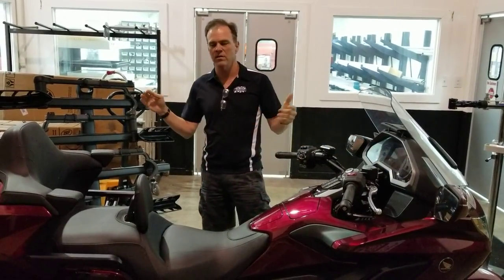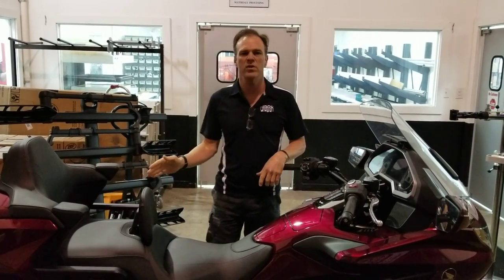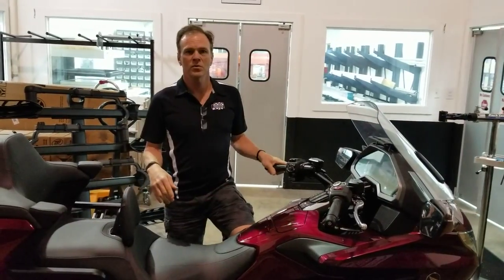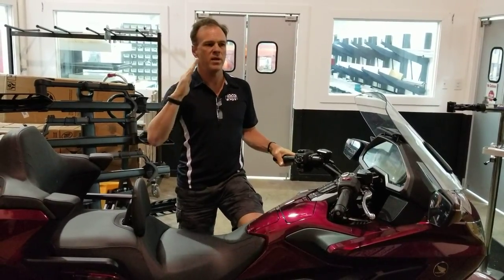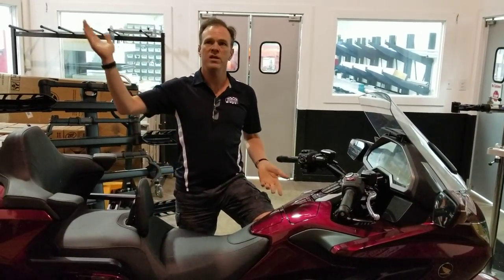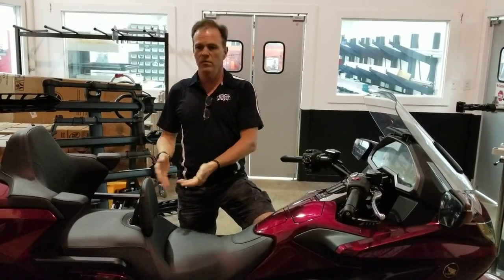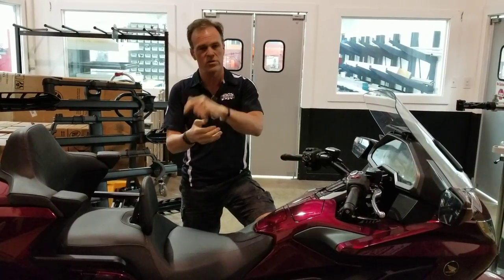At the very end of the wheel stroke there'll be a progression in the wheel rate to add additional body resistance, and it actually matches the way the telescopic fork works. The linkage lets the wheel move in a very linear fashion on the spring, creating linear spring pressure. When someone just changes the length of any piece of that structure without knowing what they're doing, the problem is you've created some bizarre wheel rate curve that nobody has tested, studied, measured, or engineered.